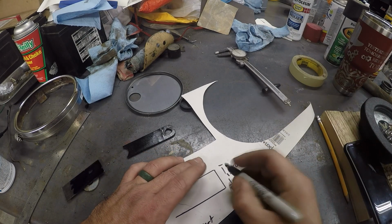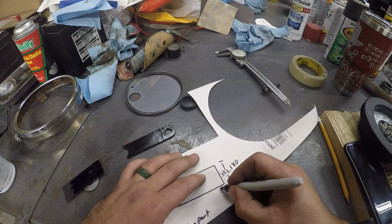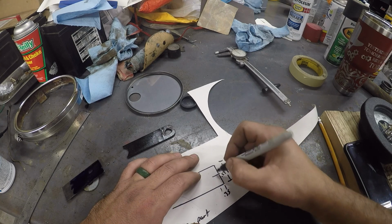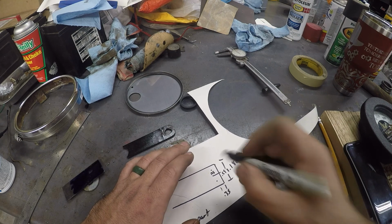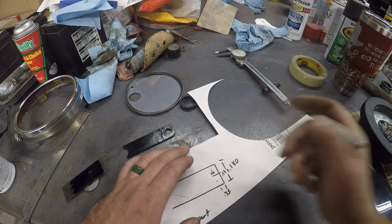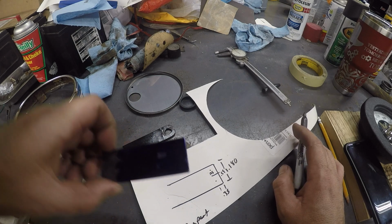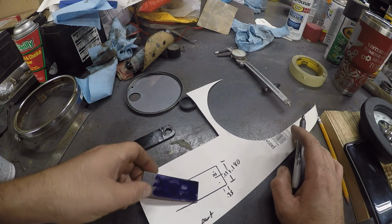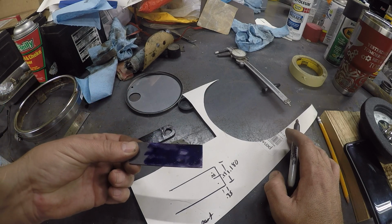So what we're doing is we found our center at 0.59, and we know our holes need to come back 0.35. And so once we find our center, then we'll come out 0.35 from each of those and find like that. That's where we'll put our center punch. So we'll do 350 on the calipers. We can scratch that, scratch this, good to go. Right, you see it's still shiny, not dry yet. I must put it on there pretty heavy if it's not dry yet, but that's okay.